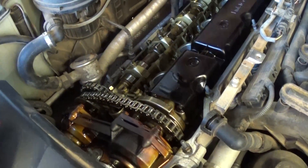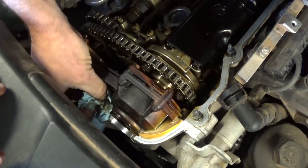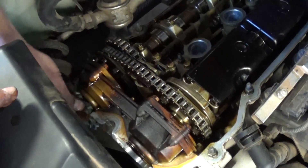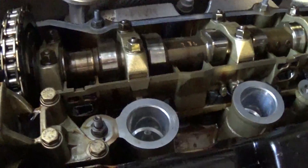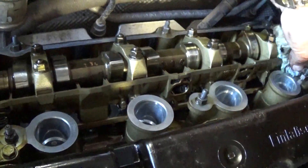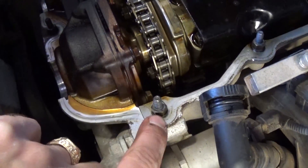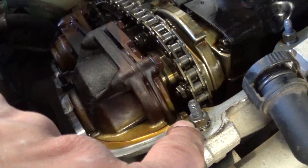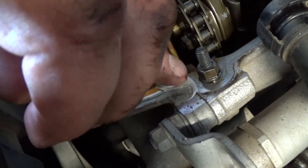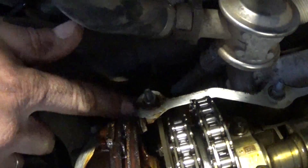Stay with us to see what you need to do properly to avoid leaks with the new gasket. First, you need to wipe the whole cylinder head right here where the gasket is contacting. Wipe it good — make sure you don't have oil deposits or anything like that. It needs to be nice, clean, and shiny. Also wipe the area in the middle where you have the spark plug holes. Now a critical part — not very many people tell you about this. Right here where the timing cover and the cylinder head meet together, apply a little bit of silicone. Just a little drop, because the new gasket no matter how flexible it is might still leak out of there — there is a little groove you can feel with your nail.